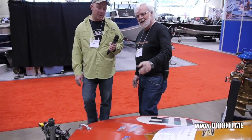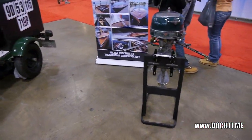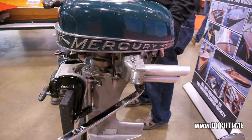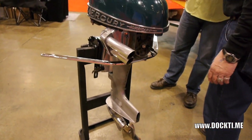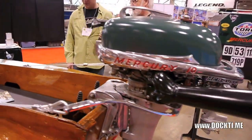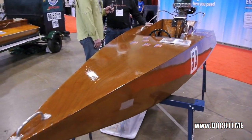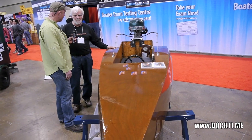We can also run the boat with this motor, which is actually a KG7 — but what I've done is, in the early days Mercury could change parts around pretty readily. So this now has a gas tank and a trim ring showing it's a 7 horsepower motor, but in actual fact it's got a block off of a 20 with rods and pistons, so it's almost a 20 horsepower motor — but to the untrained eye, you'd think it was a 7. This is a 1965 Speedliner, a junior utility boat built for a girl in New Jersey to race — it was an entry-level boat. I found it in a barn in Clayton, New York in 2010, bought it, spent a year restoring it, took it back to Clayton, New York, and won Best Restored Race Boat there last year.